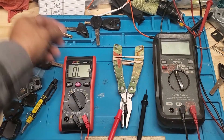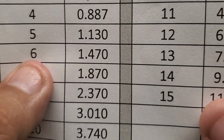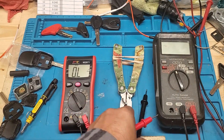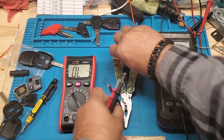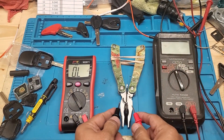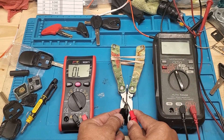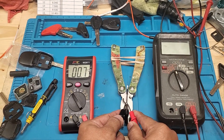Reading 1.46 — this key right here is going to be a number six. The closest value is 1.47. I've been doing this since around 1990, so I've touched a lot of these keys and dealt with a lot of these systems. I've traced a lot of the wires for the VATS systems, looking for shorts or whatever the case might be for reasons why the car won't start even when you have a key.